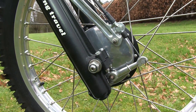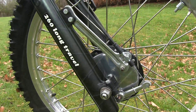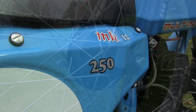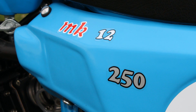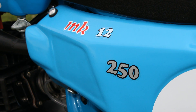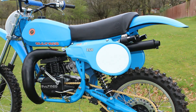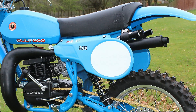The front and rear brake hubs were still in one piece, although the inner braking surfaces were corroded. These were outsourced to a specialist engineering company to be resurfaced in steel as the original chrome surfaces were peeling off. The bike also had to have a complete new set of plastic side panels as the originals were in a pretty bad state. These replacement panels were sourced directly from the USA and supplied by DC Plastics. Andrew told me these panels are not perfect but do their job amicably and are about the best you can source for these Pursang machines. The panels are vacuum formed, whereas the original 79 Bultaco panels were manufactured using injection moulding.